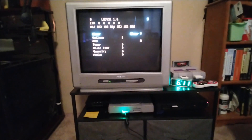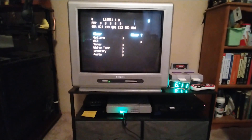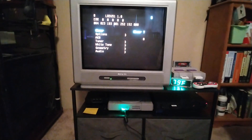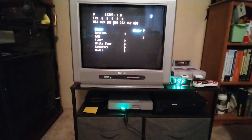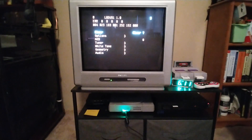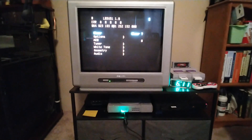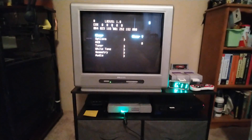Some of these TVs like to forget their option codes that make the inputs and the front panel and everything work right. When I received this TV — I got it from the dump — the option codes were wrong. I got one online that re-enabled all the other inputs. When I first got the TV, there was no option to change to the composite or component inputs; there was only S-Video available.